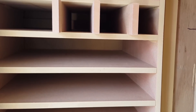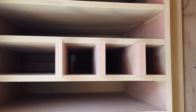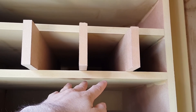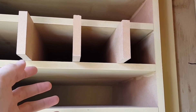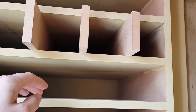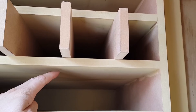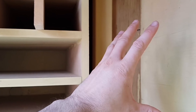The second thing you might have noticed is the discoloration on the wood. The reason is we've used fire-retardant paint. We've painted all the tops of all the shelves in a fire-resistant paint — not the type that foams up, but the type that simply won't ignite if exposed to a naked flame. That was the easiest way to go about it. We've painted pretty much all the shelf tops, and the whole back of the battery box has been painted.